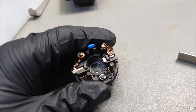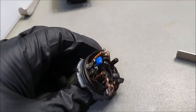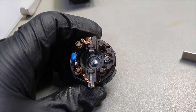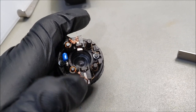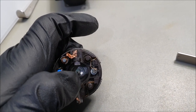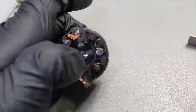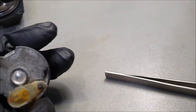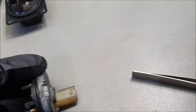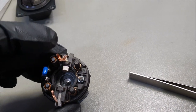I could not put these on because the spring is far out and these are sticking out. As soon as I try to put the case in, they're getting pushed in and the spring is clipping away. So I'm blocking the bearing going in. Approach number two: I'm going to punch this pressed washer out, and then try and put the bearing inside the housing first and then knock this thing into place.